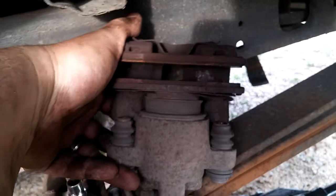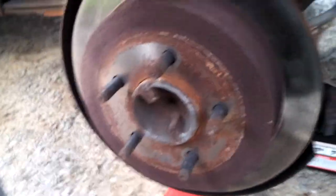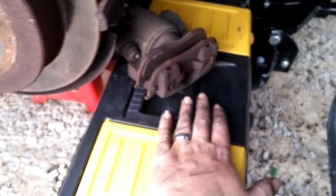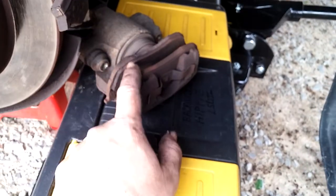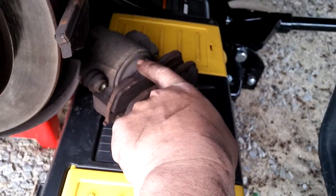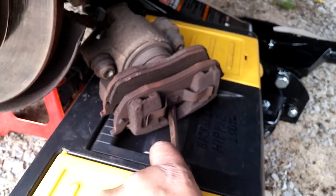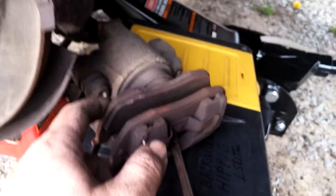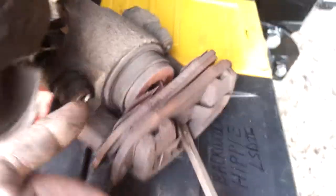You can see very, very thin — been metal to metal. If you need to change your rotor you can pull it right off and put one right back on. Now if you're going to set the caliper down, put something under it so it lays straight — don't let the hose just hang there. Because you're going to take these brake pads off and then you're going to have to push this piston right back in. It takes a basic screwdriver — you hold it, pry up on this, pull this brake pad out, and then this one pops straight out.